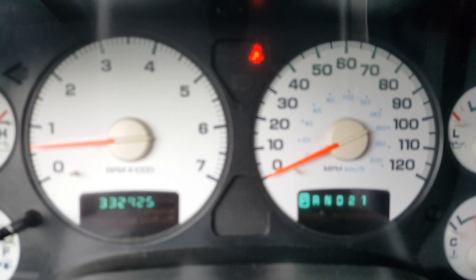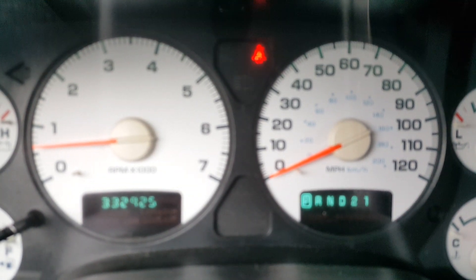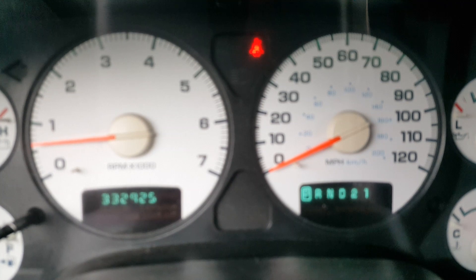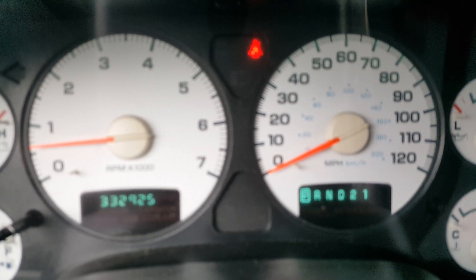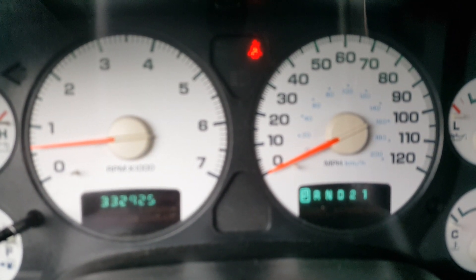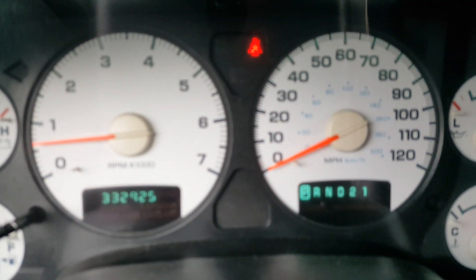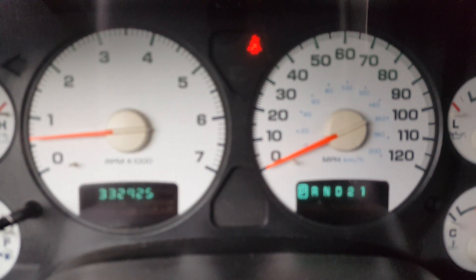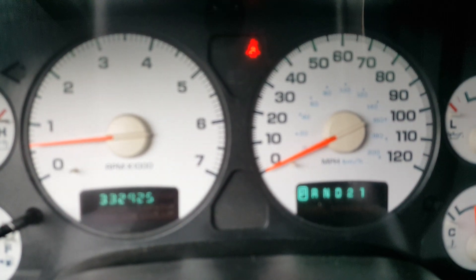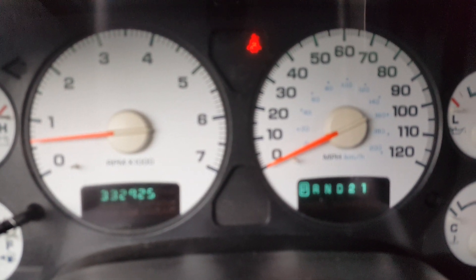Alright, I'm back. So I took the truck out for a little drive. It was right around 2500 RPM. I drove it probably a couple of minutes — like three minutes. When I got up to the stop sign with my brake on, even after going 40 miles an hour, it was really loud, still idling high. But I ended up putting it in park, shutting it off, and then turning it back on. And it's been idling perfect ever since. It drives so much better. That's all it was — just the idle air control valve being completely dirty. I mean, that thing was nasty.